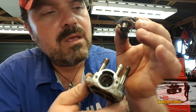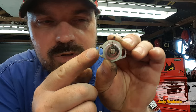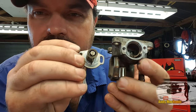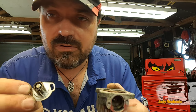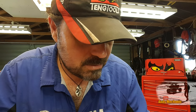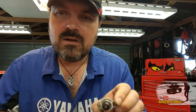Just like a plastic carrier, and then you've got the bimetallic spring just there. Now, there are different versions of these, and you can see this coiled up spring. What we'll do is mark the position of what rotates that plastic. You can see the little notch down the bottom. That's where the little tail of that spring clips into. So when the spring rotates and uncoils, or coils up, whichever it does, we'll find out in a second, it takes with it that plastic collar. And that plastic collar is attached to the rotary shaft, which is the valve, essentially. So we'll get a paint pen and mark on that casing the position of that little tail. We'll set the camera up so you're looking overhead, we'll warm it up and see how it moves. Here we go.